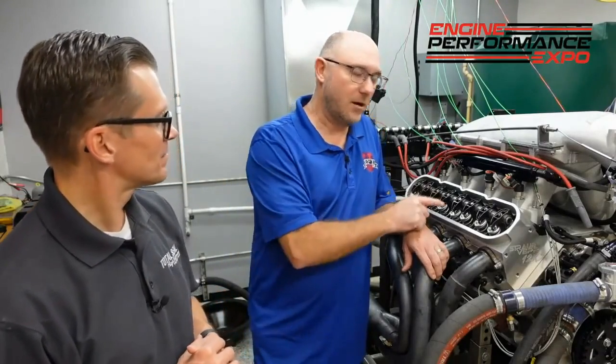If you're not concerned about pushrod length — say you've got a hydraulic lifter — it's a slam dunk. We, of course, had a solid lifter, so we also needed a pushrod change because with a stock rocker arm there's no way to adjust the valve lash.